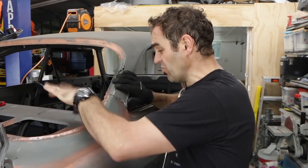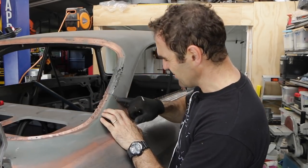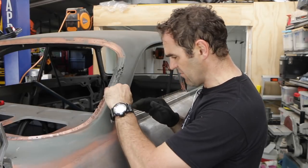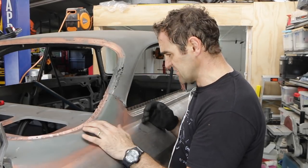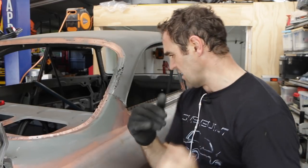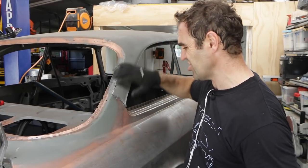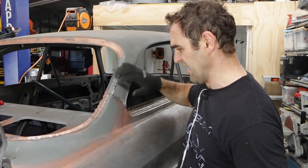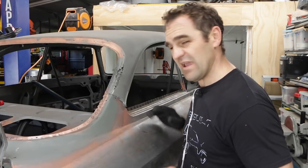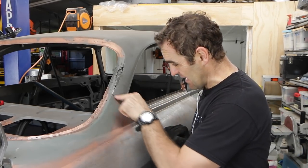Like I did on the other side's C-pillar, I'm going to go through and weld this in now. These panels are a little bit tight so I might just trim them up a bit to get a gap so I can get good penetration and so the panels push themselves together nicely — I need a little bit more space to get them flat and level. This rust I'll tackle at a later stage. Right now all I want is to get this all to be one neat piece, so let's start tackling this joint.